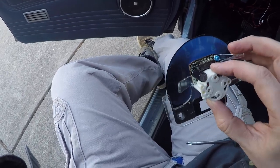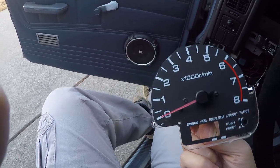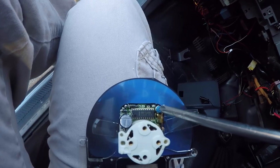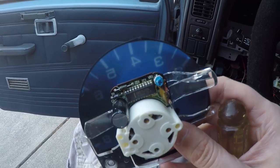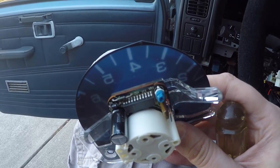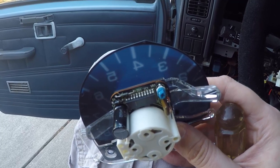Kind of anticlimactic. There's a big old capacitor and all good stuff. On the top right — or top left from the front — there's a little tiny blue guy, and that's a potentiometer. I turned it too far clockwise, so I'm going to kick it back a little counterclockwise. The little arrow should point to basically that right side of the solder joint, and that should be good enough for the four-cylinder.